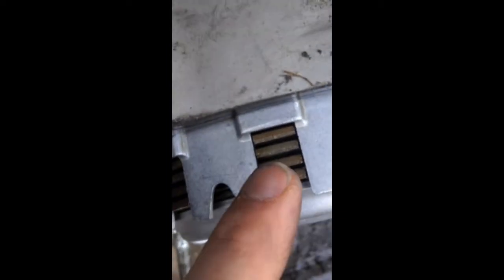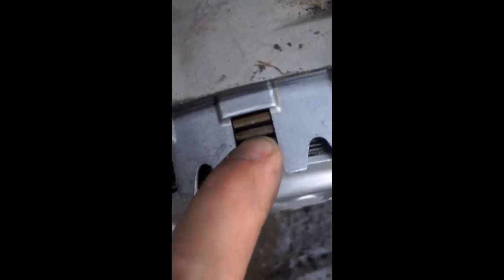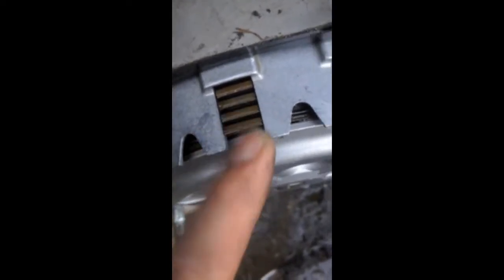The play between the discs — that answered my question. There was too much before, I assume, and now when it's in gear, it's in gear. I can't spin the back tire freely by hand anymore, so I think it's safe to say the clutch is engaging correctly.